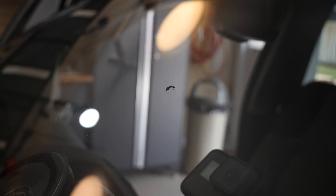So our next chip here is our half moon style chip or crack, and we're going to use a different style kit for this. This kit contains curing sheets like last time, but there are multiples because it comes with more resin, so it's meant to repair multiple cracks or chips. It also has the applicator and the mount, and it also includes a razor blade for cleaning off that extra resin. With this kit, we start with our mount, and what we want to do is make sure that we put the mount right over the center of whatever we're trying to repair — in this case, our little half moon crack. So we push down and then from the inside we can ensure that we are right over top the center of that crack.